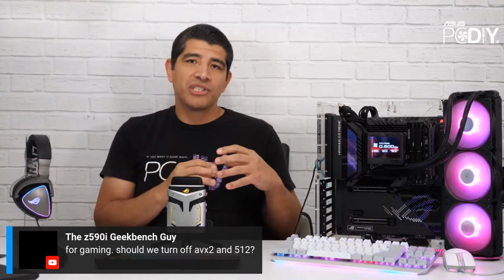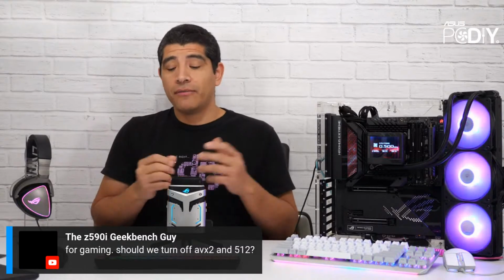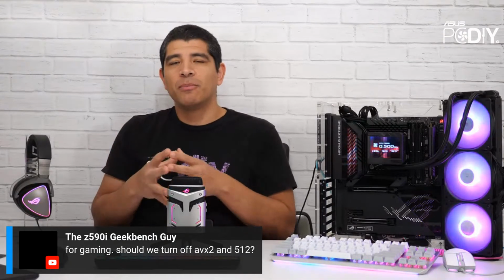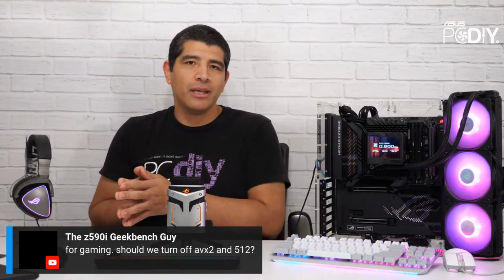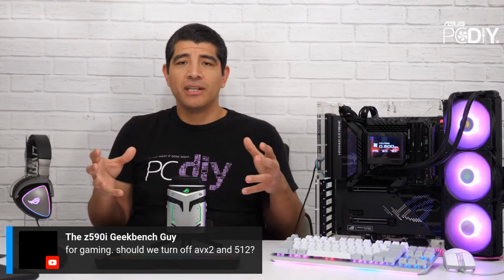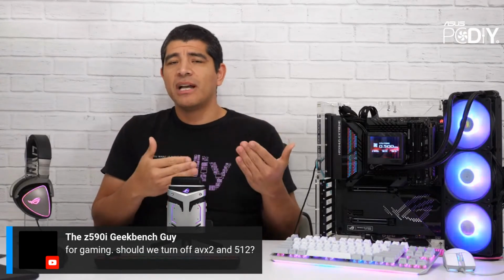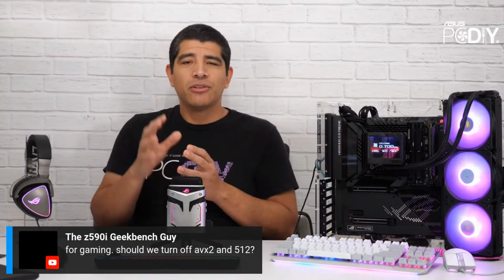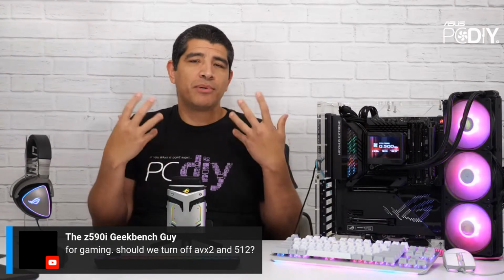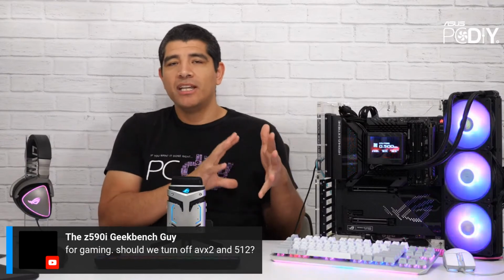So what makes more sense is maximizing your performance tuning in relation to the workload you're going to have. If you're somebody who heavily utilizes AVX workloads, then it makes sense to condition your overclock and performance parameters to align with your workload. But if not, don't worry about it. You can keep them at defaults and benefit from them when they are utilized, because there are subtle frameworks within certain applications and within Windows that can utilize them, and they're only lightly loaded, so they don't produce a heavy power draw or a lot of heat that has to be managed with your system. So I wouldn't make any adjustments to that.